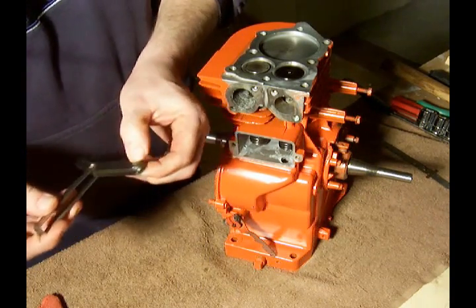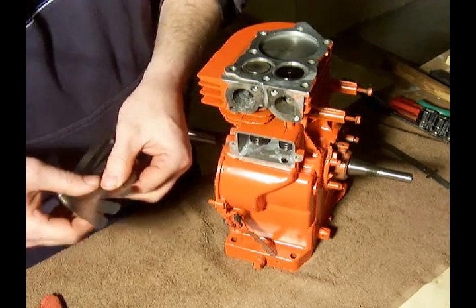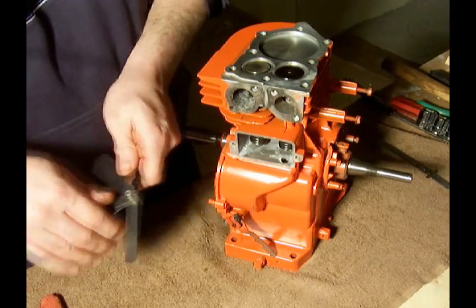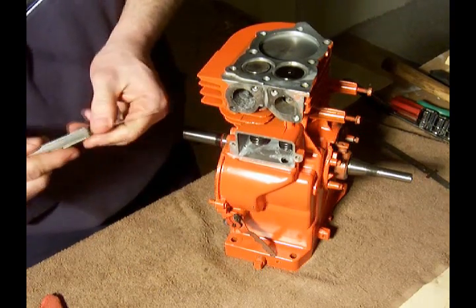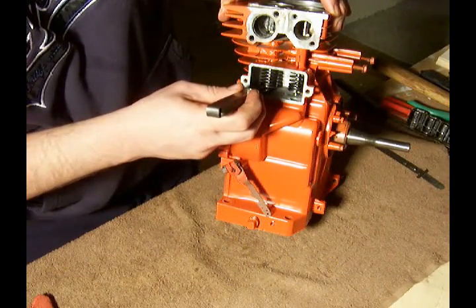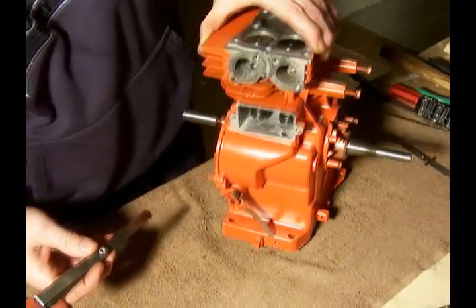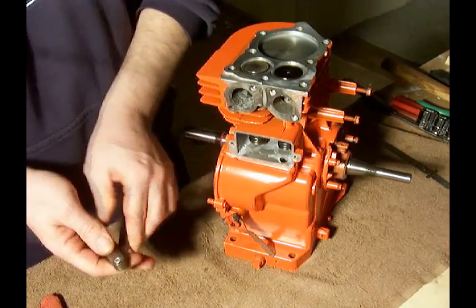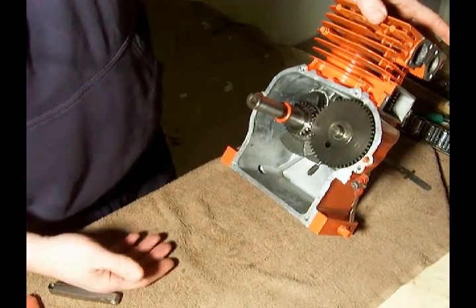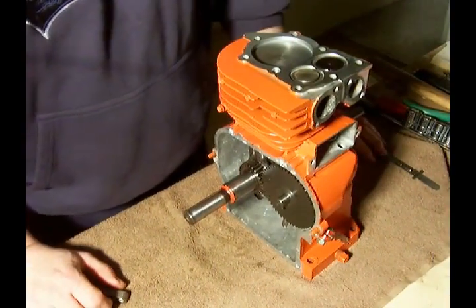Let's try the next one — 0.011. That's a much better feel. So our valve clearances are good, and the internal part of our engine is all assembled. On to the next step.